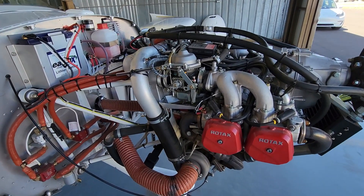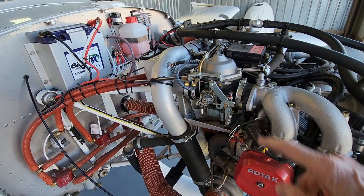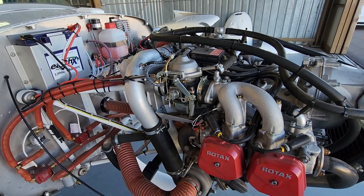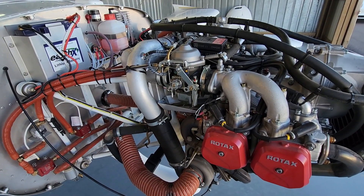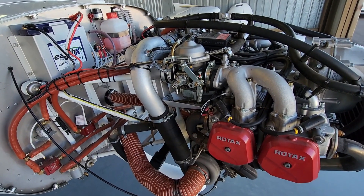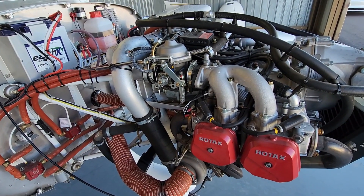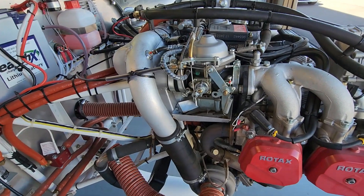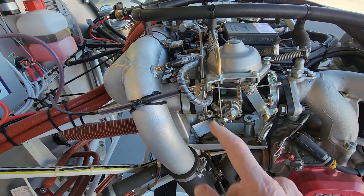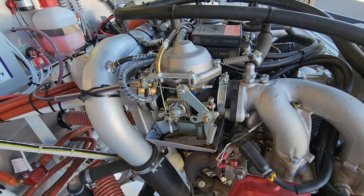First thing I'm going to sync is the idle, and I'll be doing that with the idle screws — I'm not going to be using the barrel adjustment for that. I need to get the idle adjusted; mine's about 1900 right now which is too high. So I'm going to be adding vacuum pressure to get it synced. Basically this whole thing is really pretty simple: closed idle on the idle stops is the most vacuum, the least vacuum is fully wide open. Use the idle screws to adjust the idle vacuum and use the barrel adjuster to adjust the vacuum after you get it off the idle stop.